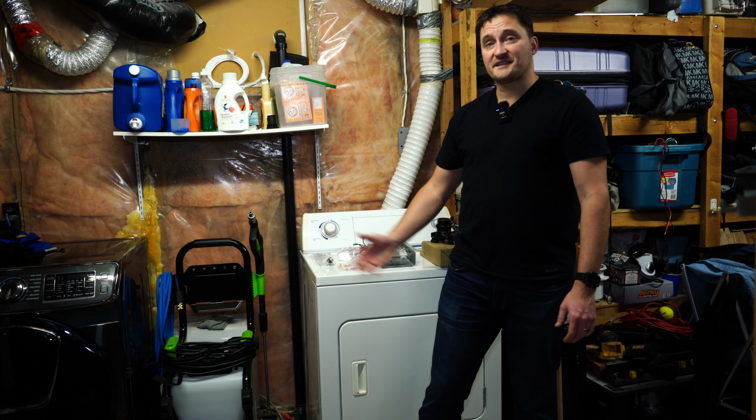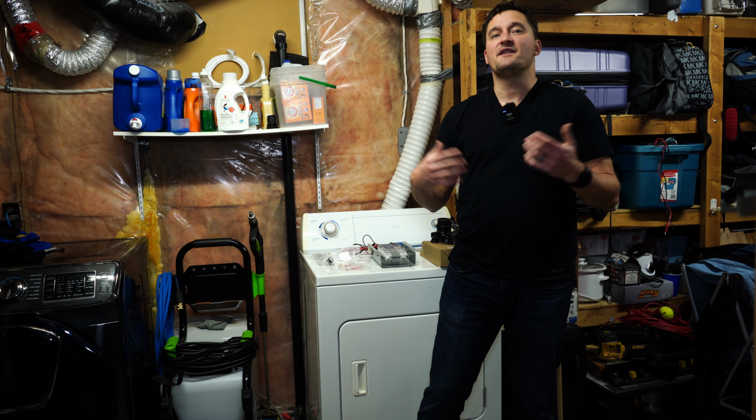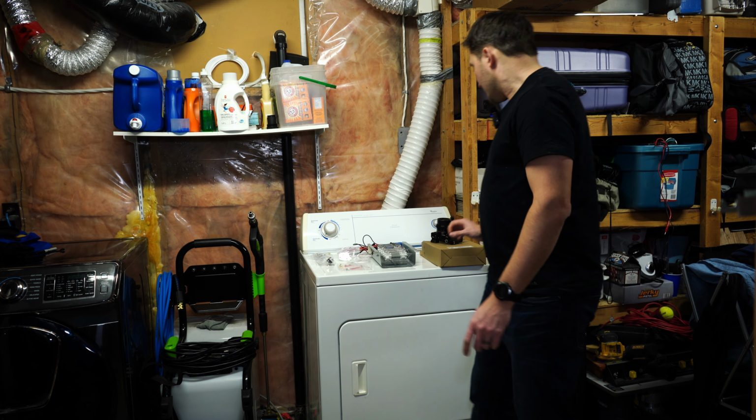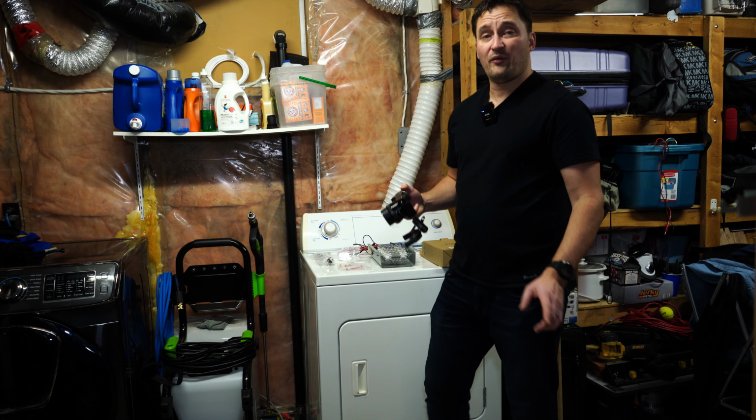If we do need anything else, I'll make sure that I point it out in the video in terms of what you need for parts. So what we're gonna do is pull this guy away from the wall. We're gonna disconnect the dryer hose, and we're gonna disconnect the power. We can get the back off, and then we can start finding where all these components are, and we can start testing things.